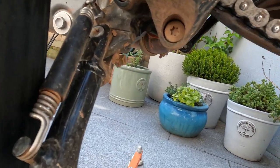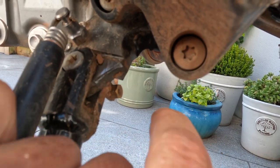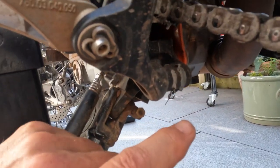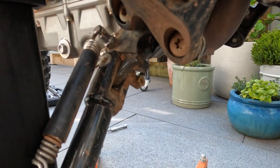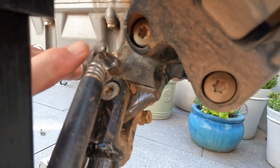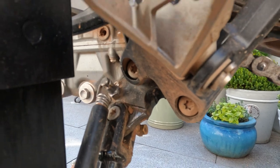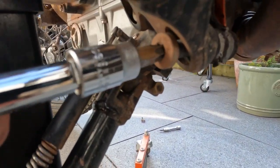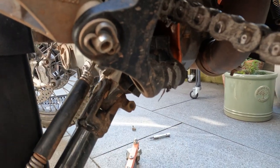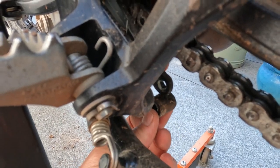In terms of the bolts that go onto the frame, we need to loosen this one here which is a T45 Torx, and then take that one out and take out this spacer as well. Then we need to loosen this one up here as well just to make it easier to get the spacer back in. This is on the gear change side. So this bolt comes out now — let's take the whole thing out. Hopefully the spacer might come out. I'm going to loosen the other bolt first. So that's the spacer that's come out — that was in there and that's where the new spacer goes.